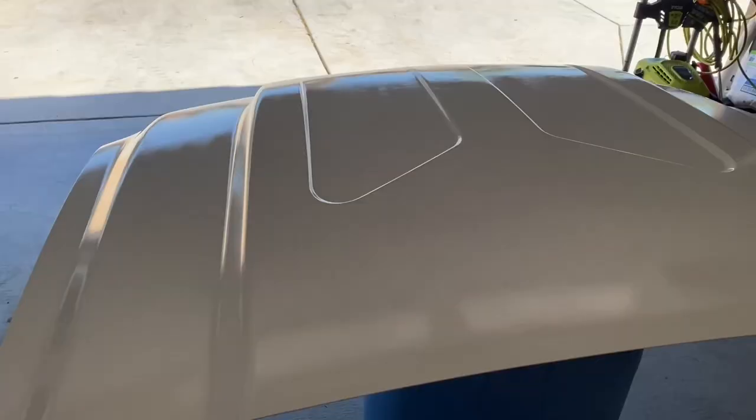It's starting to look a lot better as the paint is drying up. I'm probably just gonna leave it right here in the garage so it can dry up. Probably early in the morning tomorrow I'll give it a little wet sand and then buff it out. Let me show you guys real quick how it's looking.